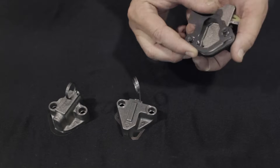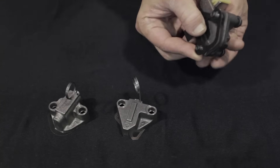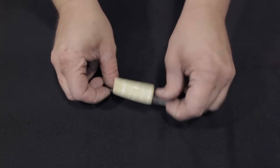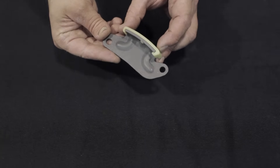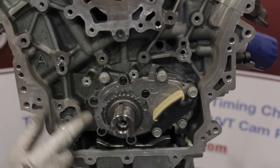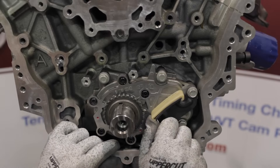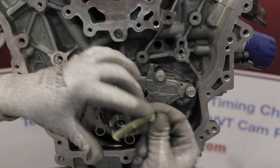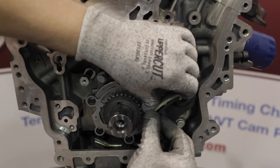Note the tensioners are also shipped with gaskets that utilize a tab feature to index the tensioner bolt threads. It is best to install the gaskets with the tensioner bolts before installation on the engine. The lower primary guide that we left on the engine during removal is attached using critically torqued oil pump attachment bolts. Unless you are servicing the oil pump, it is best not to remove the lower guide bolts because it will disturb the oil pump's properly torqued two-piece housing. Cloyes recommends replacing the nylon shoe using the nylon from the provided guide assembly in the kit. Use a small tool to separate and remove the nylon shoes from the steel guide brackets and reinstall the new nylon shoe on the engine's original bracket.